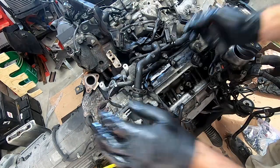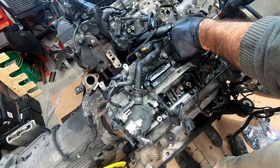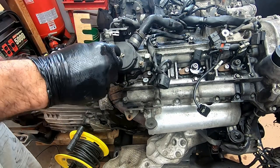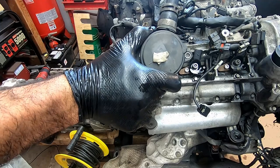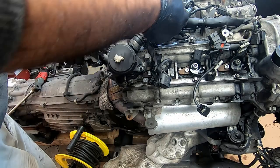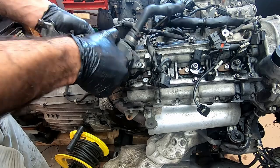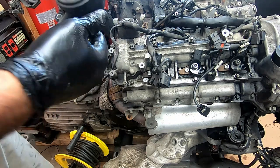We have to get rid of the crankcase ventilation there — disconnect that bit, and we actually have to disconnect all of the glow plugs, which don't seem to want to budge. There's the crankcase ventilation system out. These do fail — I think I'm probably going to replace this one. One thing I do want to do, because this is a very short inlet right before the turbo, is that a lot of folks relocate this and basically pass it up front through an oil catch can and then back in. This hose is pretty old and there is an update for this, so I think we're going to end up getting a new crankcase ventilation system.